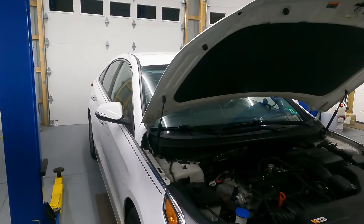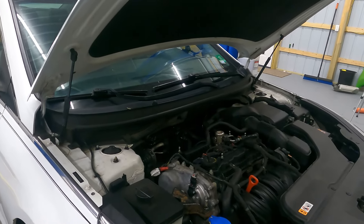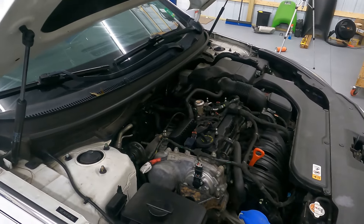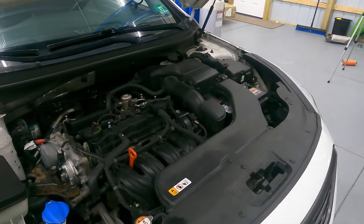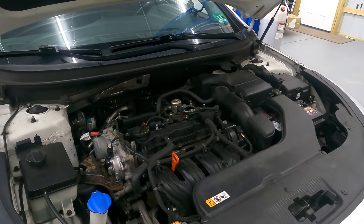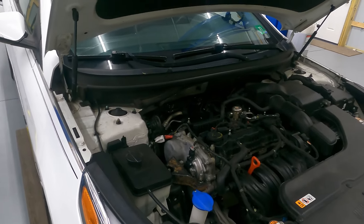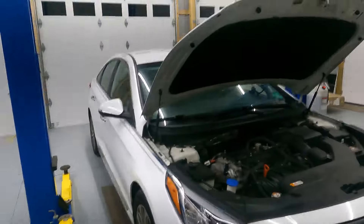I hope this video helped you in the diagnosis of a P0010 in your Hyundai or Kia vehicle. We've gone ahead and ordered roughly $1,500 worth of parts — we got the approval today. We're going to do the cam phaser, replace this cap again, and put a timing chain in it with tensioner and guides. Definitely stay tuned — we're going to get down and dirty with this Hyundai Theta engine, get it down to the timing system, re-time it, and replace everything. Like, share, subscribe, and stay tuned — we're going to have some fun with this thing.